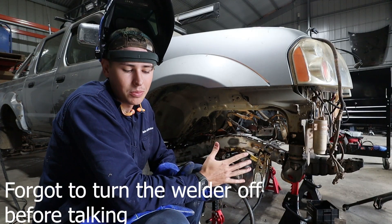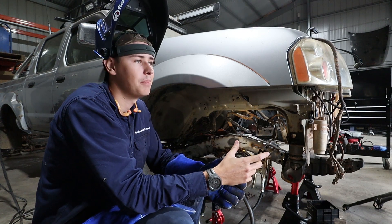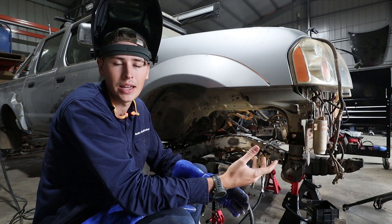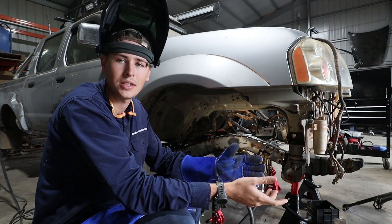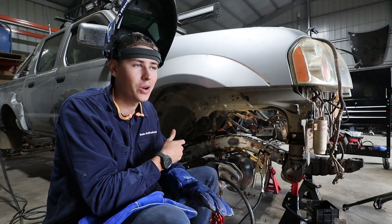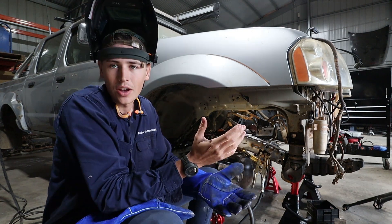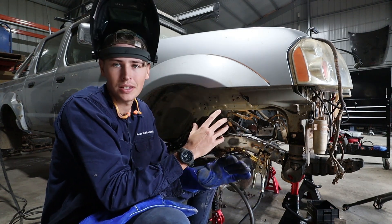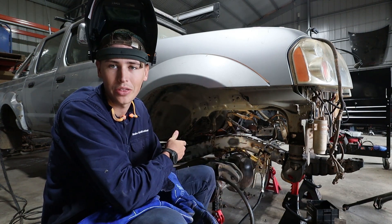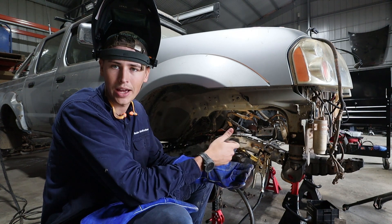Matt from Crawl Customs told me that you don't actually have to weld this chassis laminate all the way through — just a couple of stitches along it are fine. However, I thought it would be better to weld it all the way through because that means it's airtight and there are less places for stuff to get caught and lead to rust. The key thing is you can't weld it all the way through in one go or it will bow, bend, and twist. Just run a couple of beads here and there, then come back later and finish it off.